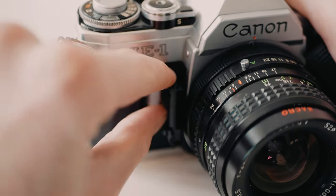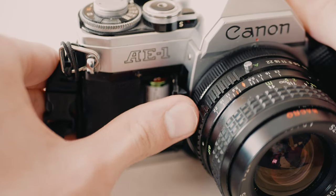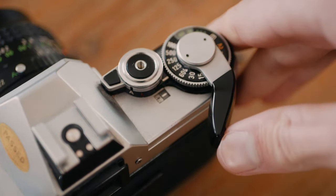A few minor features worth knowing: this camera is fully battery operated, so if you don't have a battery it won't work at all. It takes a 6-volt battery, which is common in most film cameras and can be found in most camera shops for around $20 — they'll last a few years. Being a 35mm camera you get 36 or 24 photos per roll, and the shot count goes upwards on this camera. If you forget the count, once you finish the roll the camera won't allow you to advance further. If the count goes well above 36, there might be a problem — I once shot a roll that reached 42 and realized the film hadn't loaded at all, so make sure your film is loaded properly.